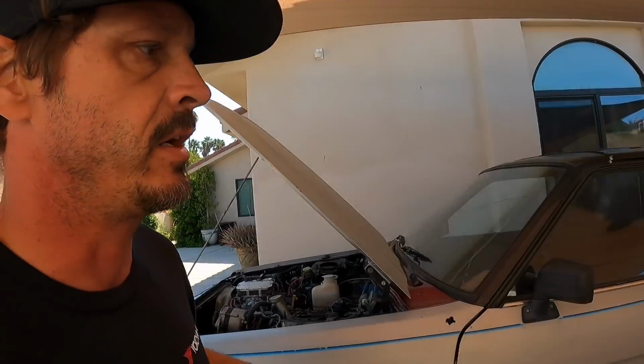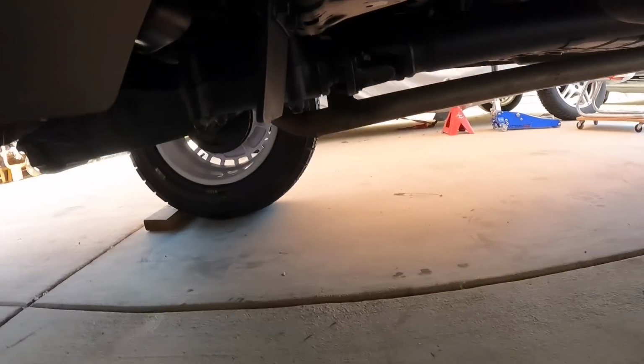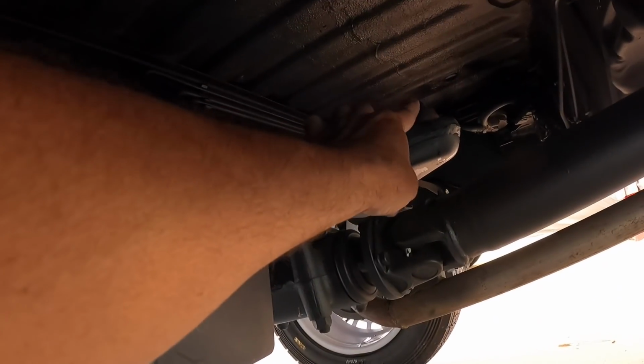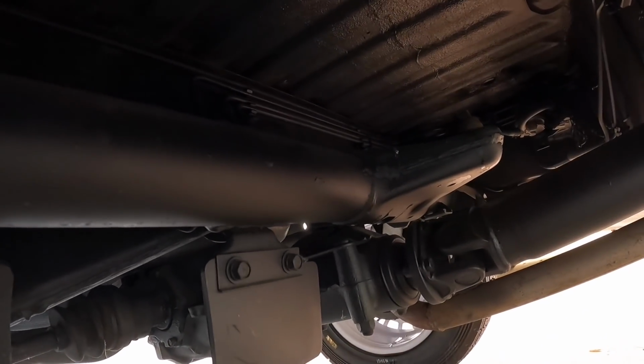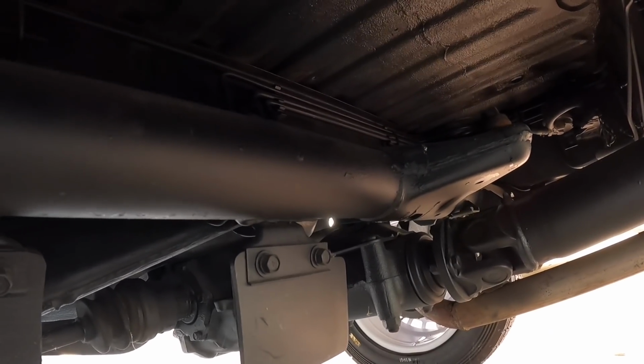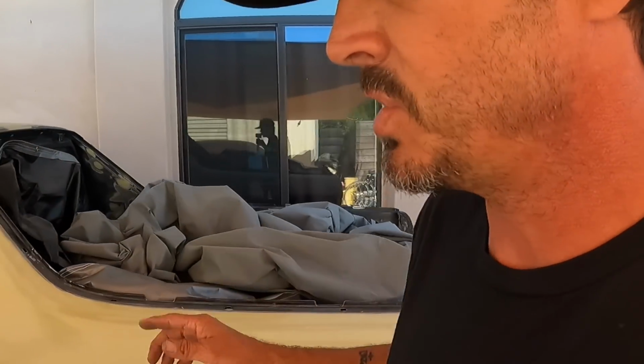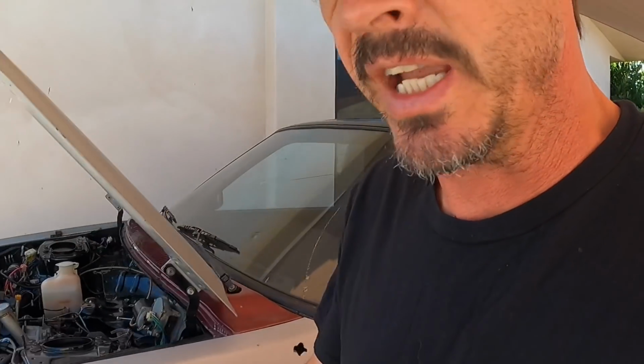And for everyone out there on the back, we already mounted the wheels on the rear. And all I did to get some more height out of the rear was right under here, this bolt right here adjusts the torsion bars. And by cranking that down, I probably gained another 1/2 to 1 inch of height out of the rear of the Brat. So the rears were really simple and easy. And now we're gonna lower it down just to get a visual on where we're at as far as height.